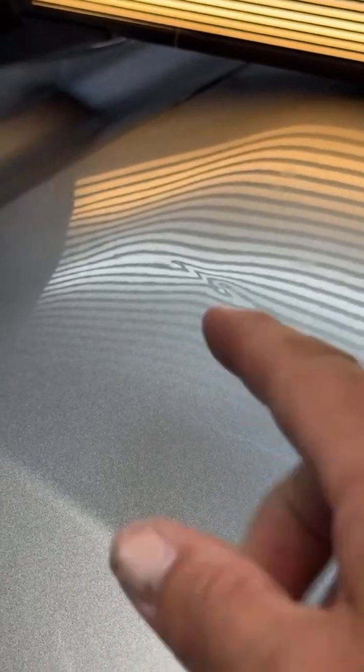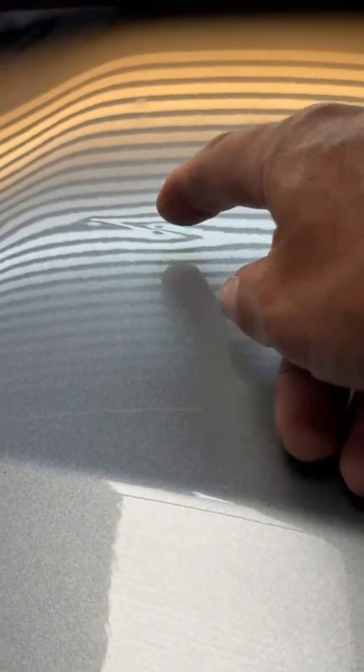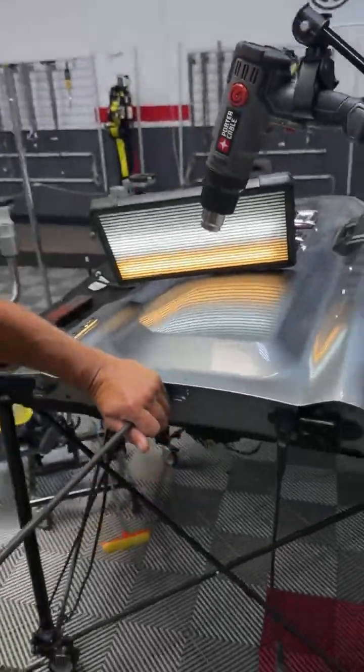Here are the do's and don'ts again. If you're looking at it like this, this is the wrong way to do it if you're using reflection because you see the lightning bolt? That means the way you're looking at it is wrong. The way Josh is looking at it is going with the dent. This is a traveled crease — you can see that. So that's what Josh is doing.